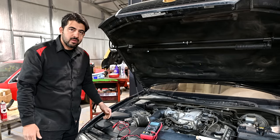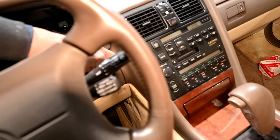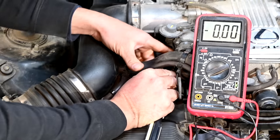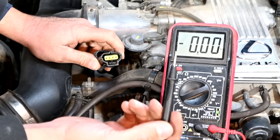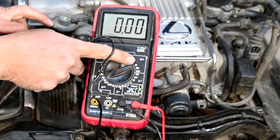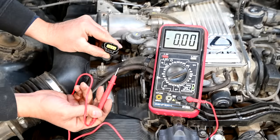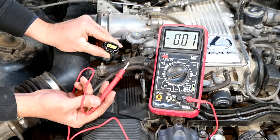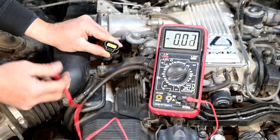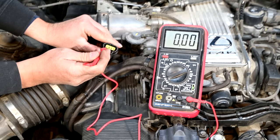Let's get on to diagnosing our throttle position sensor. In order to do that, we need to figure out which wire is what. First thing we're going to do is turn the key to the on position and then remove the connector from our throttle position sensor. We'll get our black test lead and ground it at a good ground, preferably our battery. Make sure to set our multimeter to 20 volts on the DC scale. Then we're going to probe these pins and we're basically looking for our 5-volt reference voltage and also the 12 volts for the idle switch on this car. We'll start from the left — the first one on the left, we've got 5 volts.